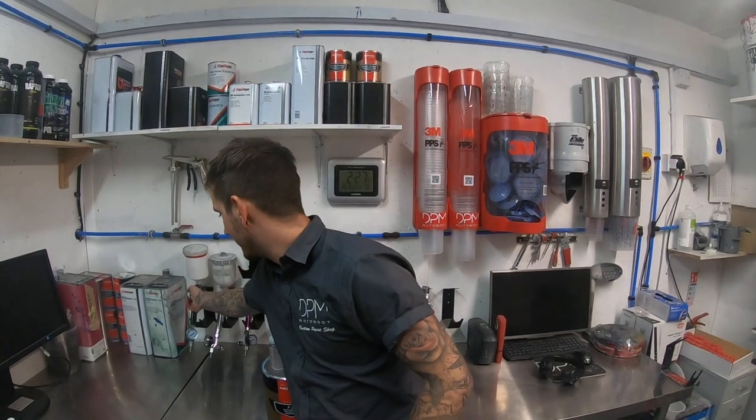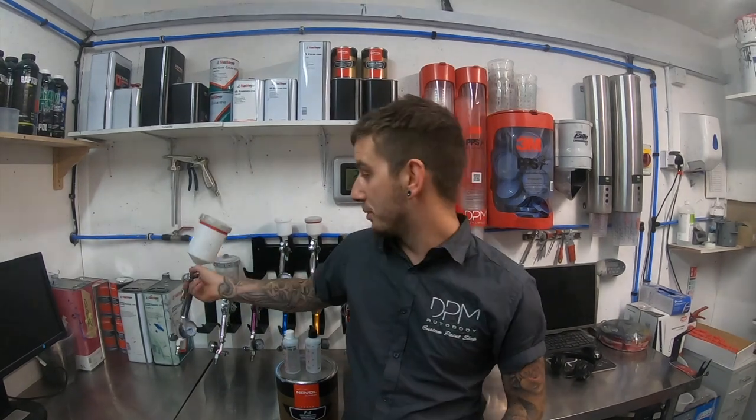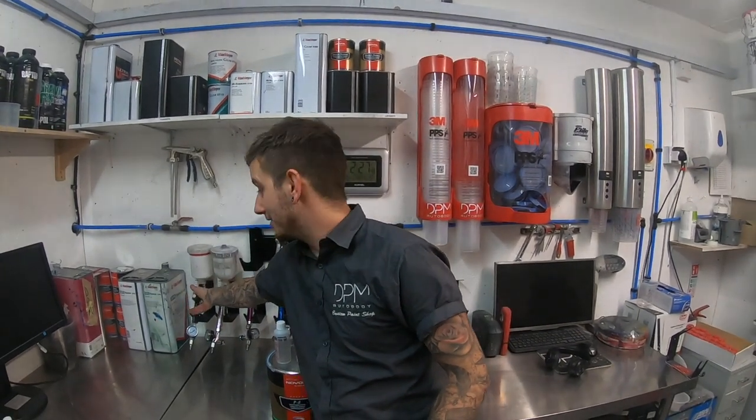Another important thing when you're doing polyester spray filler is you need at least a 2.5mm spray gun. I recommend this size 100B. Brilliant gun, not too expensive, and it lays it on just like a high build primer. And also have a second person mixing the polyester spray filler for you. It takes quite a lot to get it mixed, and you always want two people doing it because it's a pain in the butt if you're trying to do that and spray it. So let's get it out and we're going to start getting it blocked down.